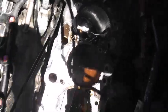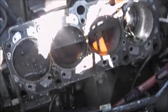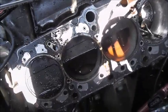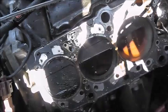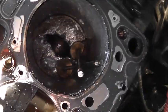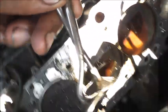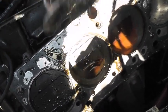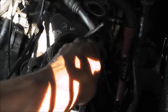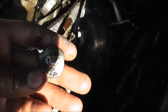So we can see the issue here. Don't mind the water in the cylinders — that's because I lifted the head off and tons of water came out. So let's have a look. We have two valves which I pushed out by mistake. Look at that — bent. And we have another valve here which is the exhaust valve, and it's completely destroyed.